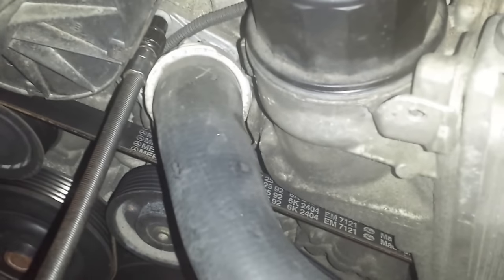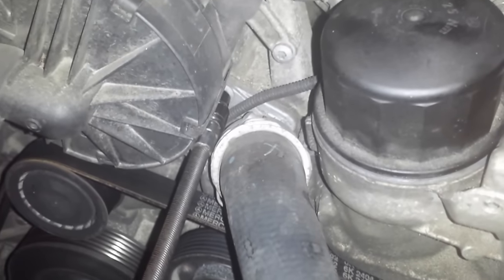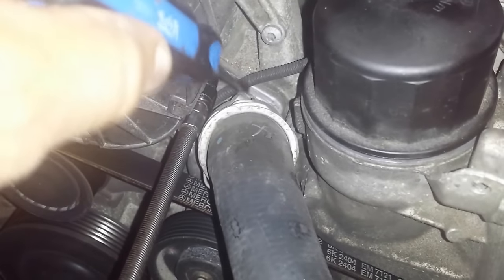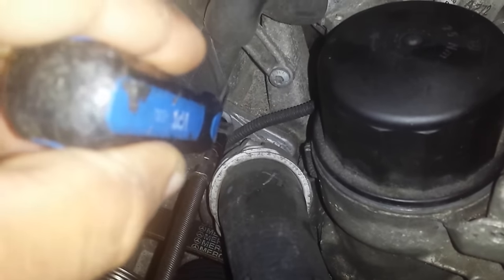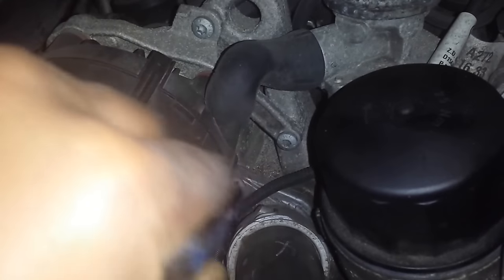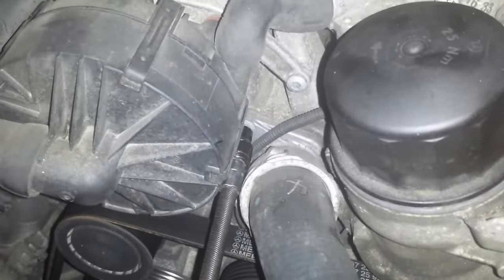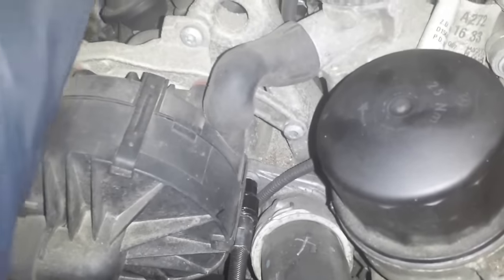All right. So we're going to be removing the thermostat, which is this housing right here. It's connected by 10 millimeter star bolts. One here, I already have a socket on it, and one underneath. And we're going to be replacing it